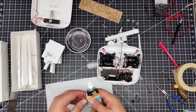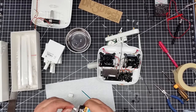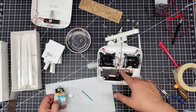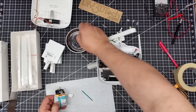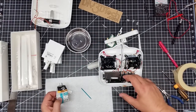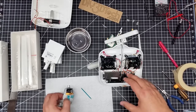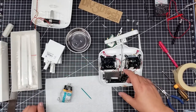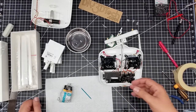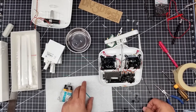One thing I wanted to go back to is protecting these connectors. I've noticed on the internet a lot of folks are going with hot glue — that is probably a bad idea. Why? They don't use hot glue on these from the factory; they use a silicone adhesive. I'm going to use an aquarium-based marine silicone — 100% silicone adhesive — to cover these back up. Moisture to microwave radiation is evil, so you want to protect against any moisture getting in here. I'll use a little toothpick to apply it.